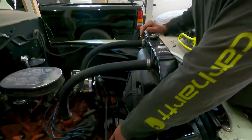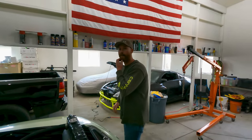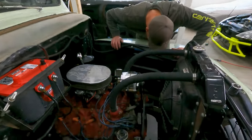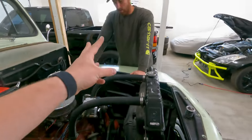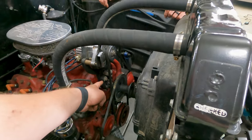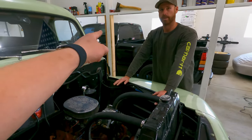At the same time, if you had to replace this water pump, you're like — man, I gotta replace the water pump and the engine mount. But it's still easier than a water pump on a BMW where you have to lift the whole engine. You have less to replace. It's like working on a lawnmower. Modern engines have belt tensioners — you undo this bolt, stick a long rod under here, lift, and that's what tensions the belts. It's actually a breath of fresh air — I think it'll be a learning experience.